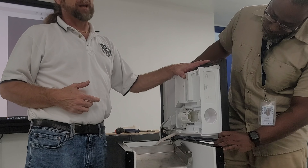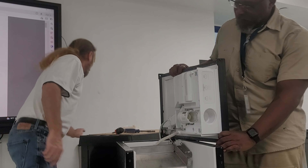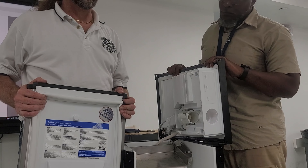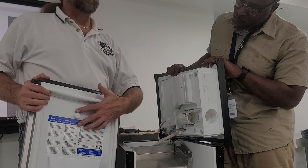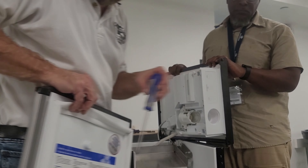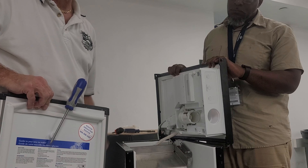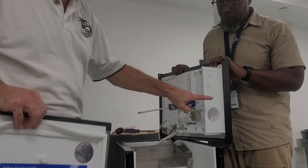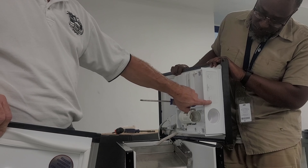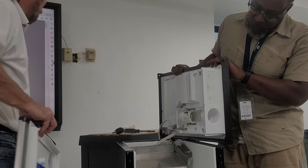When you open the door and the magnet's not there, it turns the light on. If you look here, where do you think that magnet is? That little indentation right here — that's the magnet, so it lines up somewhere. The reed switch is here in the corner, but we have to get to it through the controls.